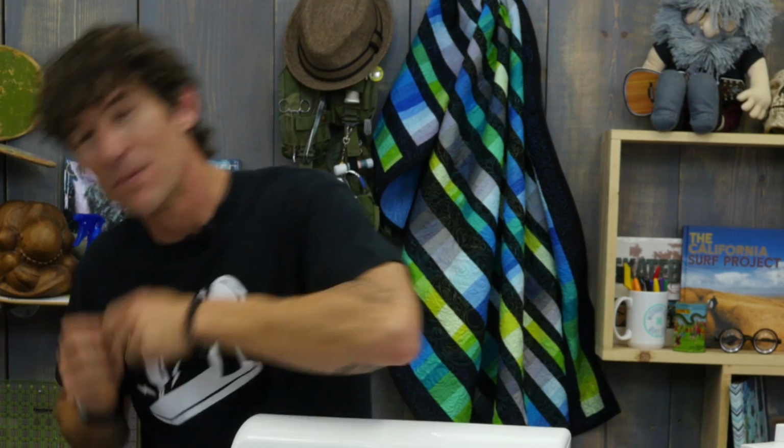Every now and again, you can get a bad needle fresh out of a package. So instead of stopping quilting all day, I put a fresh needle in to test the timing. If it doesn't work, I take another fresh needle. Put that in. If that doesn't work, I'm not taking 3 strikes. I am going in for a service. But if the first needle didn't work, I'm still checking a second needle just to make sure that it really is the machine and not the needle.